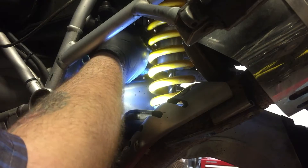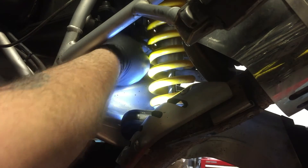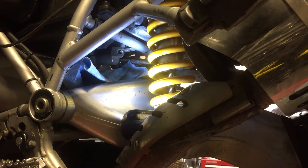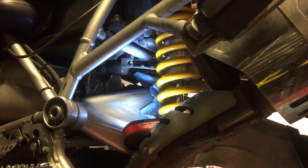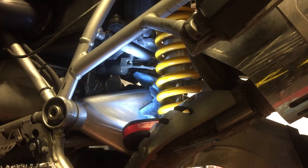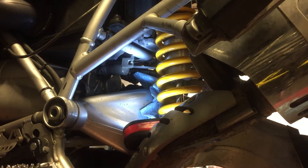Let's go around the other side and see if we can see it — it's a lot easier to see from this angle. It turns out that bolt is not actually a T30 Torx like I said, but a five millimeter. George hooked me up with a long five millimeter and an extension so I can get to that other bolt. And there it goes. Use the right tools and it makes the job really easy. So we're going to pull this other bolt out, and that will let us pull the whole slave cylinder out.